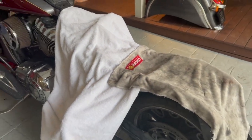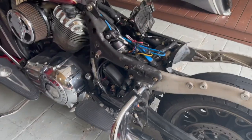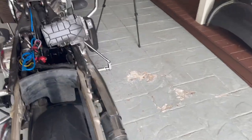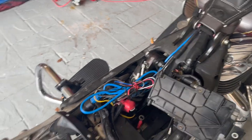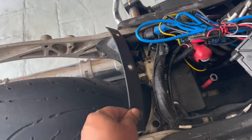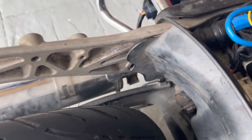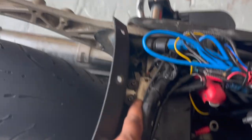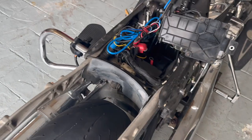Good morning — it's a new day and both sensors are changed. Just a reminder: you can save yourself the trouble of removing the battery by just taking out that small mud guard. Before you remove it, take photos of how it sits in the grooves on each side so you know how to put it back. Remove the two nuts, take out the little connector, pull the mud guard out, and you can reach the speed sensor connector from the back by hand.